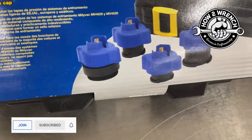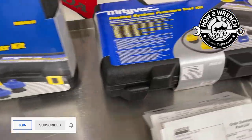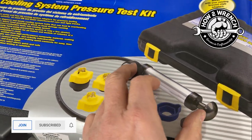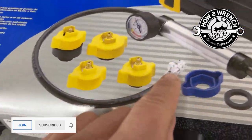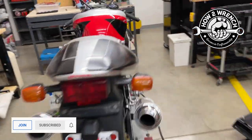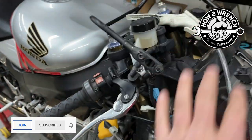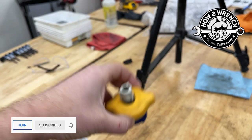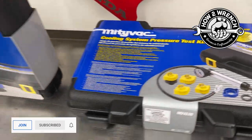This kit has a bunch of different adapters for numerous domestic and Asian cars. This is what I called the traditional one earlier — you have just the cylinder that you pump up. It's sure a lot faster than the little handheld one, but this is more for the pro doing this type of testing all the time. You can see there's a quick release fitting to attach up to the different caps. On the motorcycle kit, you get what you pay for — so this one is more what I would call the do-it-yourselfer. You have to unthread this, take the hose, and re-thread it on here. No big deal, but for the pro doing it day in and day out, that's why you'd go to a kit like this.